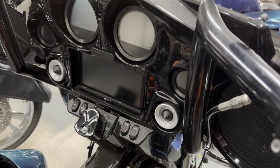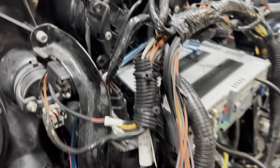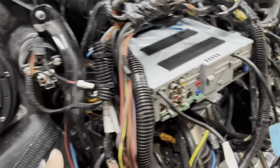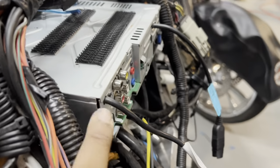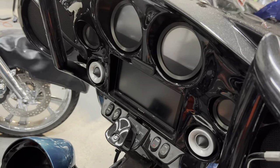This is another 13 and down Street Glide, but this one has an aftermarket fairing. Same issues on this one — you only have the space here. But on this one, instead of going on the side of the DSP, it can go under the radio, because since it's a Sony radio, you have space there. But same thing: if you don't get the amplifier tight to the end of the radio chassis, the fairing will not close. Street Glide running the Metro fairing.